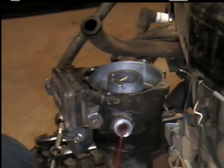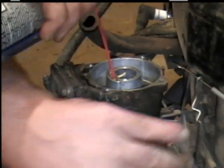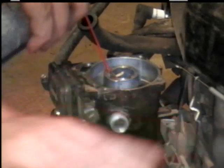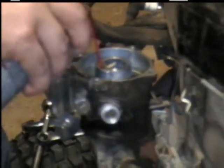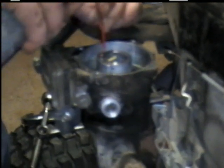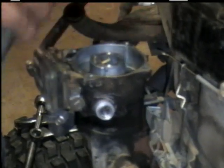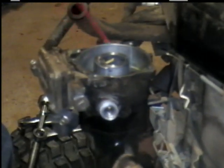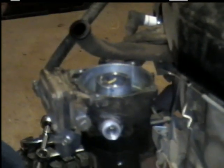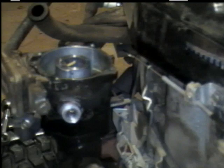And kind of take it and blow back through them again. Blow anything you knock loose out. Put my hand over it so it doesn't come out and hit the camera. Like I said, make sure you got something under it to catch the extra, and kind of blow it off. Do not get it on your diaphragm. Blow your thing off, your little float.